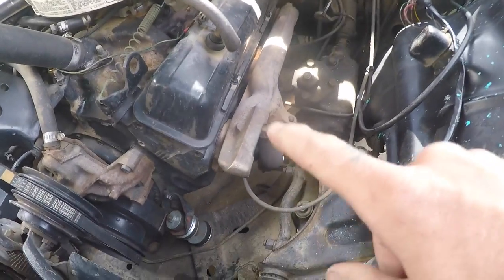For today's video I'm going to cover why your Chevy sounds like it does. On a lot of Chevys you're going to encounter a problem where the exhaust manifold gasket — where the exhaust manifold actually meets up to the motor — has either blown out or become corroded and is leaking, either at the back next to the firewall, which is predominant on the 454, or around the bottom on most 350s and 305s.